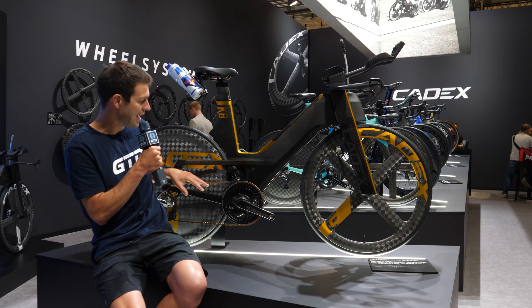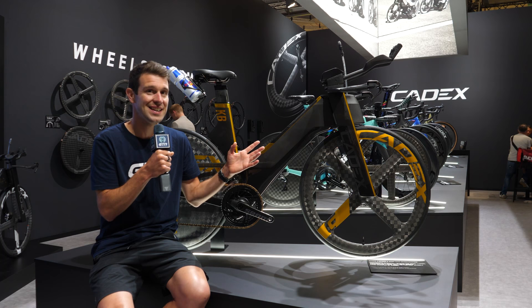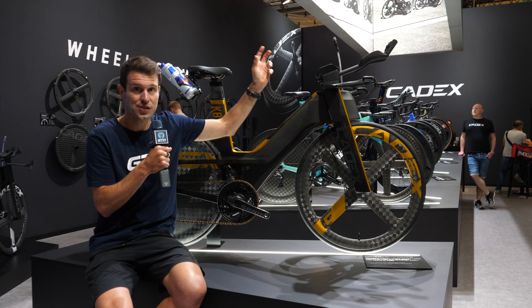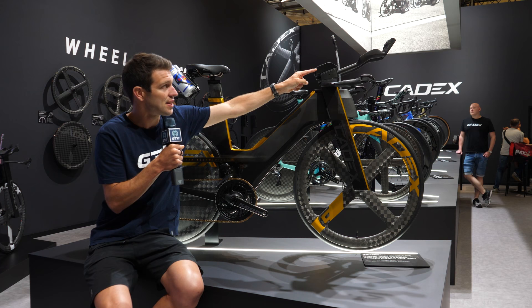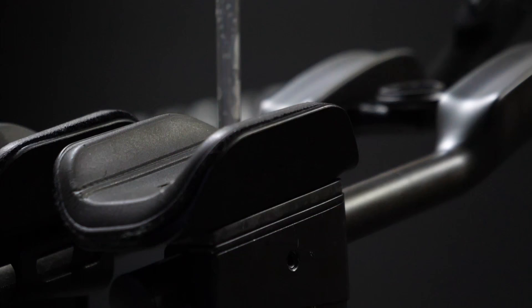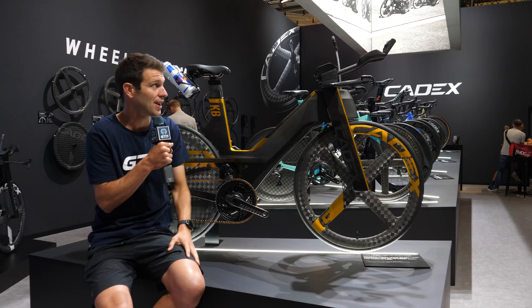The hosing runs down through into the bladder very nicely. The bike also has horizontal seat stays that come off for aerodynamic reasons, giving an incredibly thin profile at the back. The forks came from an interesting discussion with the engineer — they initially started with this design for ease of adjustability. Whereas previously on their Trinity you had to change out bolts and remove loads of shims to increase or lower the height, they wanted to make that easier. They've got longer bolts that come right down into the forks, and spacers can be removed sideways easily rather than having to remove the whole system.